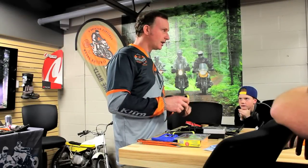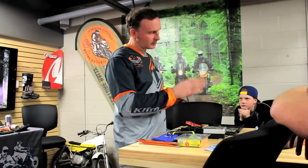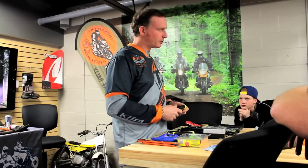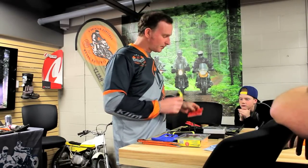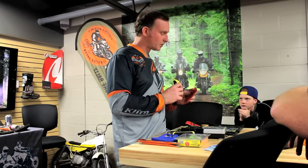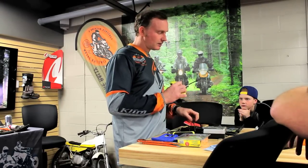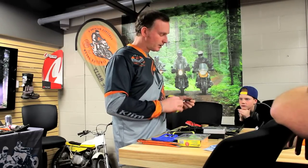Let's say you get a nail in the tire. Tire goes flat, do your little inspection. Oh, there it is, there's a nail. You pull it out with your pliers, have a good look at it. Does it look like it's going to be about that size or less? Can I fix it with what I've got? Yes. Rough it out to get any junk out of there.